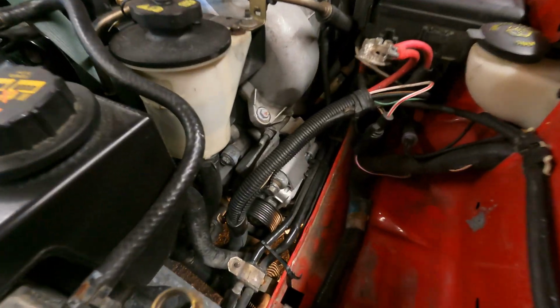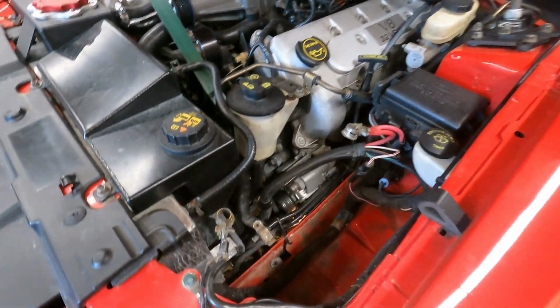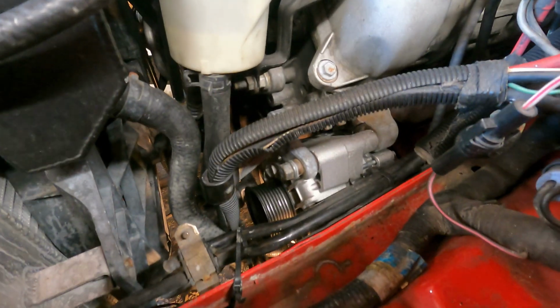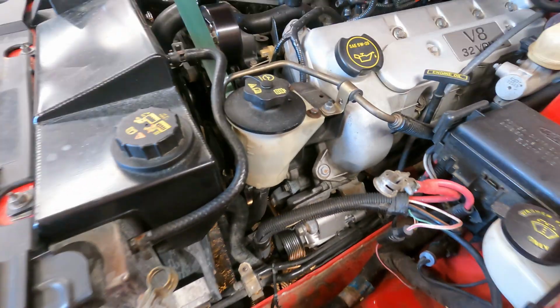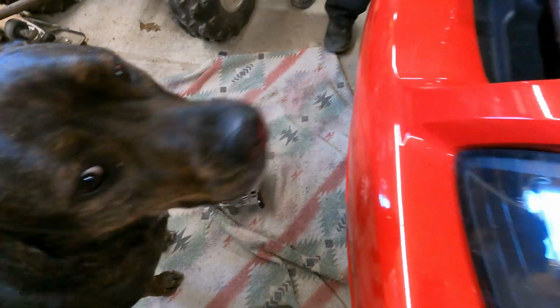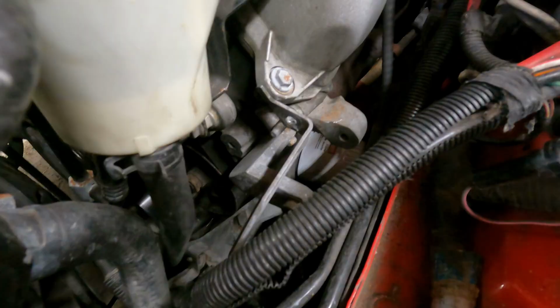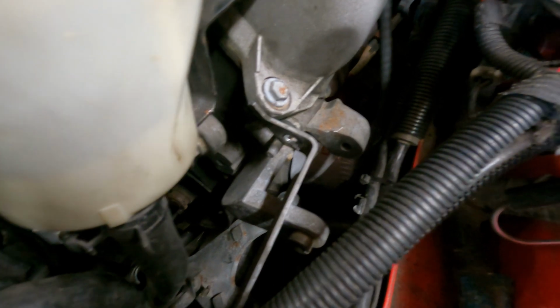At this point, we're getting the alternator out of the car, and the directions said to take off the upper mount for the alternator and to grind away a part of it for clearance because this is a bigger case. I tried getting that upper one off, but the bolt didn't want to come out and I didn't want to risk breaking it, so we decided to grind it from the bottom. It worked just as well as taking it off.